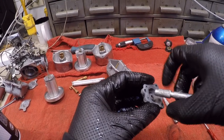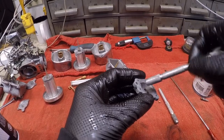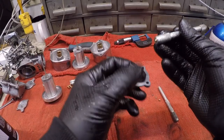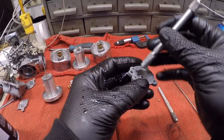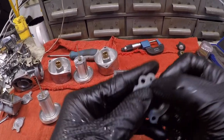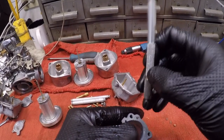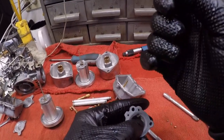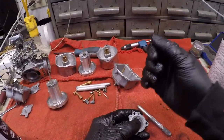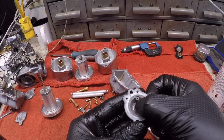And I'll put a link below of where you can get drill bits like these. But that went all the way through and it's clear. But more often than not, what I see is this hole right there completely caked to the top, and you really got to work at it for a long time. Use a flashlight, look down in there. You should actually be able to shine a flashlight onto this hole and see light in that little brass tube right there.